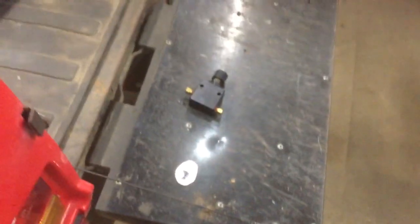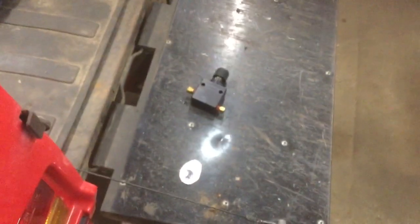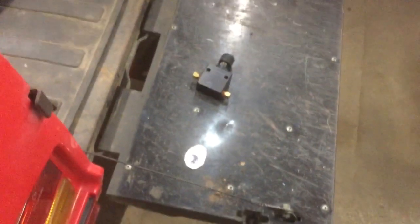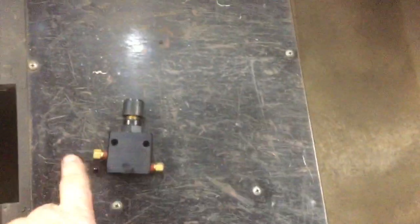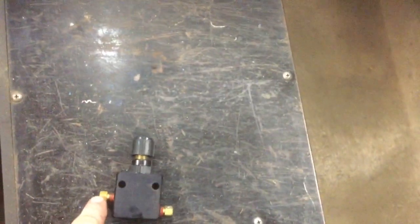So of course I started at the back and checked it. No brake fluid coming. There was brake fluid in the line, but no pressure. And I came forward and then I took the out, in and out, or out and in. Let's see which one this one is. This is the outside. This is just like it was on the car. I unhooked this and stomped on the brakes. Dry as a bone, nothing. So then I went around on this side, took it off, just started to rest my foot on the brake, and I could hear brake fluid coming out.